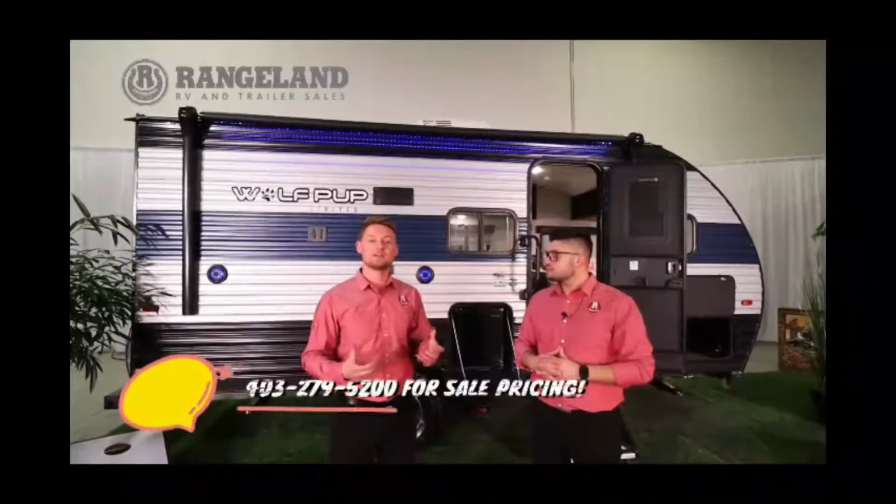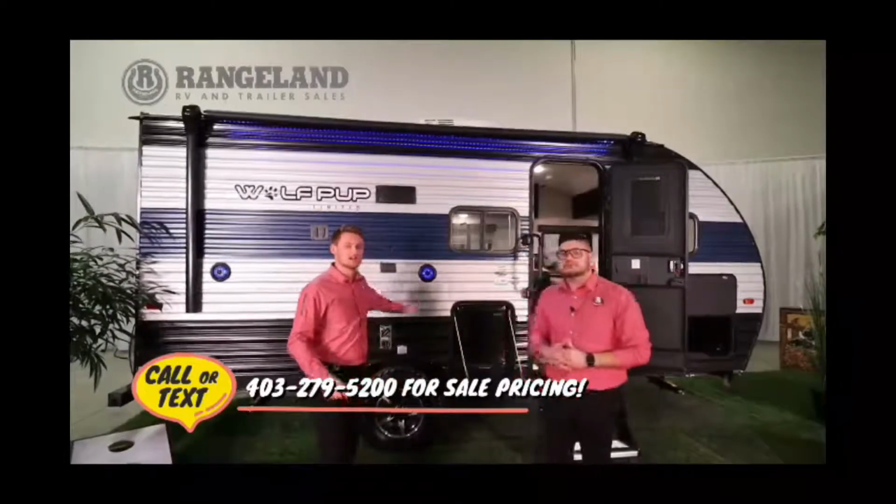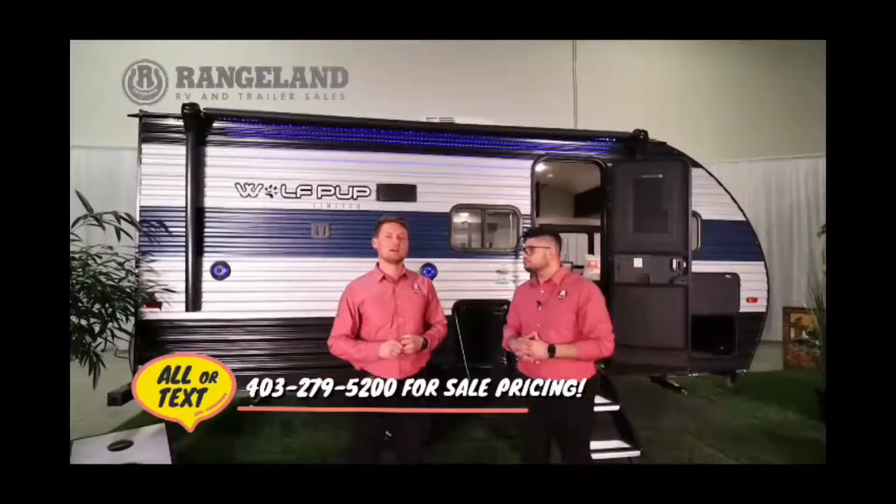One of the biggest things we jump into when we first start talking to someone about one of these Wolf Pups is the construction. When you start comparing this to a lot of comparables in the industry, you're going to start hearing things about the stud construction in the floor. What we like to tell you about is the 12-inch on-center studs behind this aluminum siding. The big reason we talk about that is our competitors do a 16-inch spacing or even 24. Having that 12-inch on center gives you more structure, because this is like a house that goes through an earthquake every single weekend you use it. So more structure, the better.